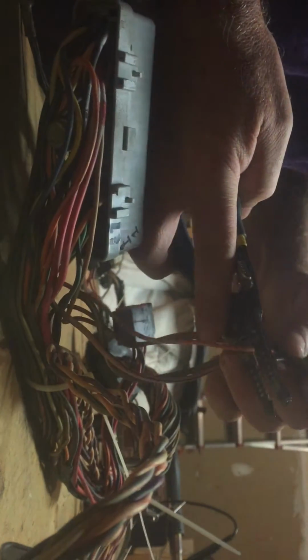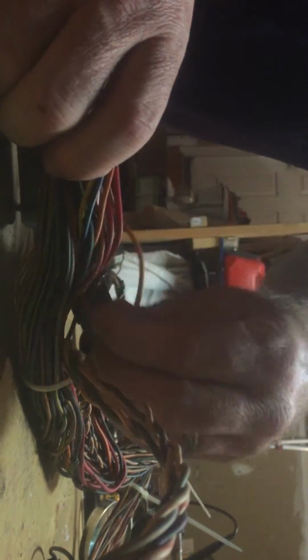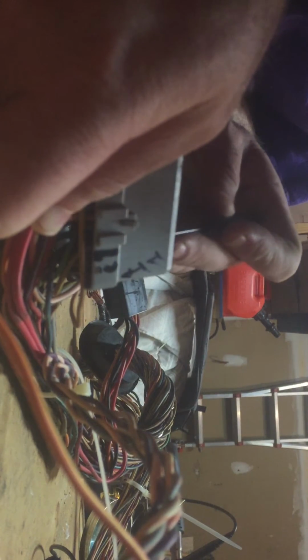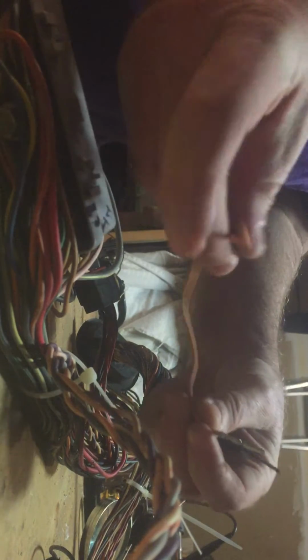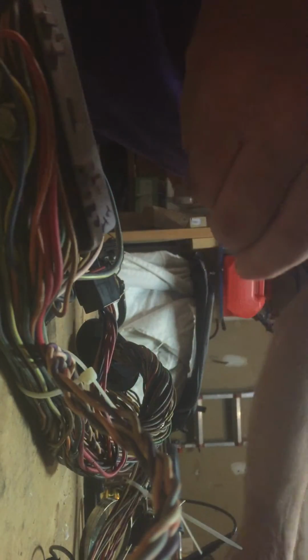All right. I like to save these wires with these connectors on them because you can use them if you do any kind of repinning or if you have wire damage. All right, so like I said, 1, 2, 3, 4, 5, 6. I slide it down, just down the side with a little connector. Boom, comes right out. Okay, and see, I don't know if you saw that or not, but it came out. All right, so that one's out, and that's just one less wire I have in my connector. All right, so that's what I do. I'm going to do that with several other ones.